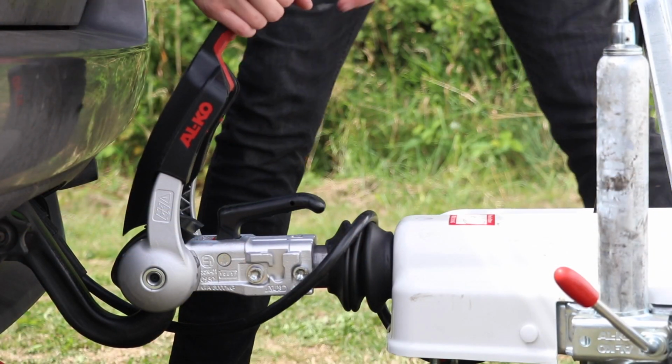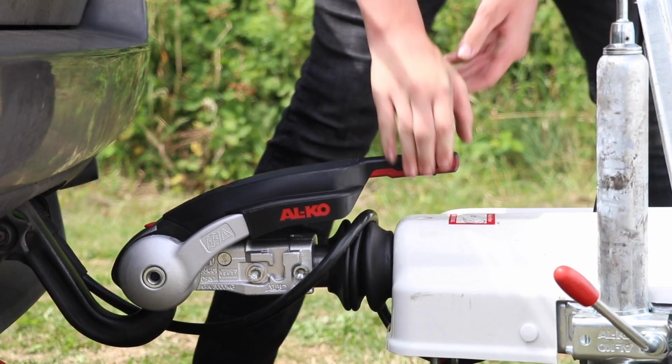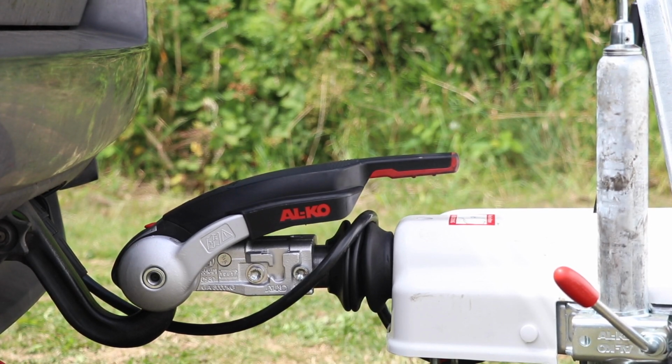Many modern caravans will have a stabiliser system that's based in the hitch, but they will not stop a badly laden caravan from snaking. They will assist it, trying to prevent it stopping it, but it's not the cure. The caravan needs to be set up first for the hitch to even have a chance.